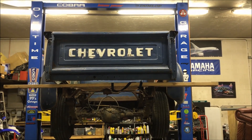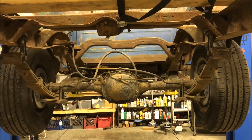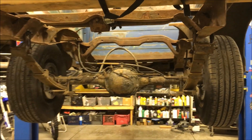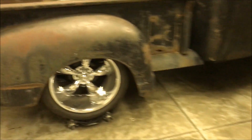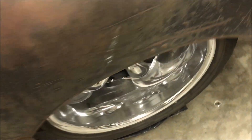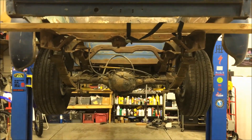Okay, overtime garagers, we have reached another milestone getting this rear end swapped. We had that crappy Ford nine-inch which was a little wider, and now we've got this S10 10-bolt, which is a little narrower. That'll allow us to run a wider width wheel and tire, similar to what's going on over here. You can see that's reaching out to the edge of the fender real well and that's 10 inches wide on a 20-inch wheel — I liked the way that looked, and we'll do that again here, although it might be a different style wheel.